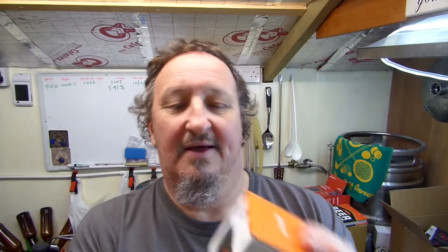So what we've done now is I've been online, and you can buy replacement thermostats for eight pounds starting, for a generic one, going up to 70-something pounds for an official Bosch one. It's like ink for an inkjet printer — let's try and rip the customers off. So how do we fix this without spending eight to 70 quid? The answer is one of these. You could use a STC-1000 — that's got heating and cooling — but for two pounds less you can get one of these. This is an Elitech EK-3010, it's got buttons up and down.